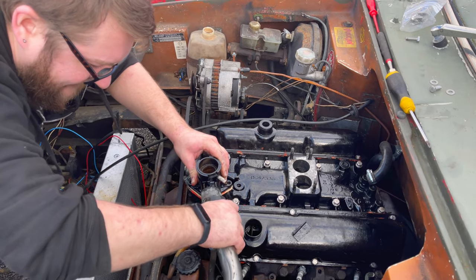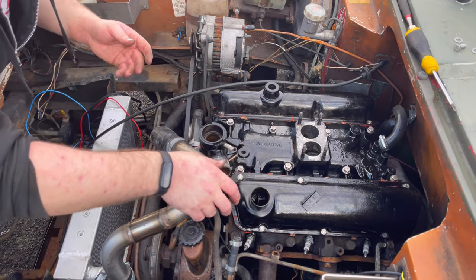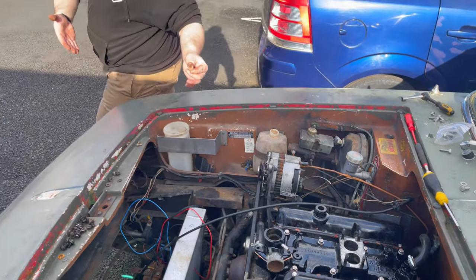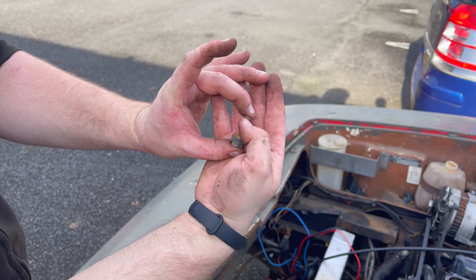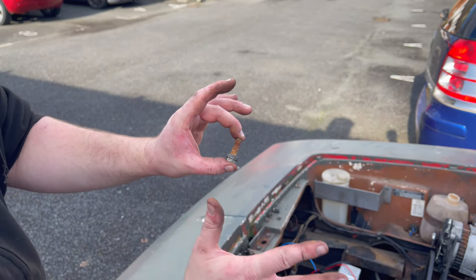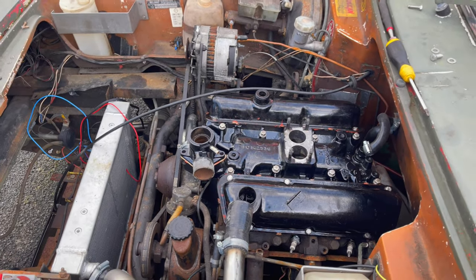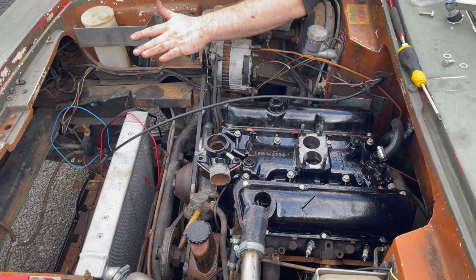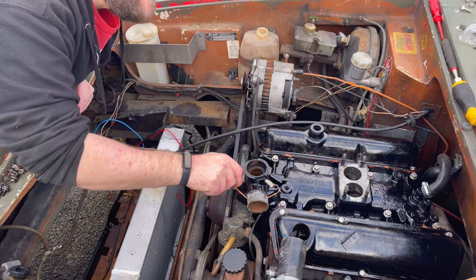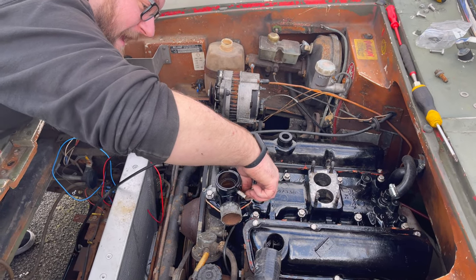While that's on there I'd rather just have this tube out of the way. Okay, it's come out everywhere — right. These are the bolts that came off the car. Not really much thread going on there, and they've got a nice stack of washers, so I'm assuming it didn't come out of the factory like this. We're going to be looking for replacements — this kit here is literally just for the top end of the engine. The rocker cover bolts were separate but they're all new. It's such a shame — it was looking so good and now I've got orange RTV everywhere.